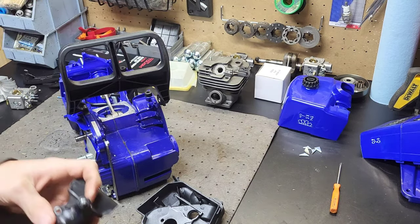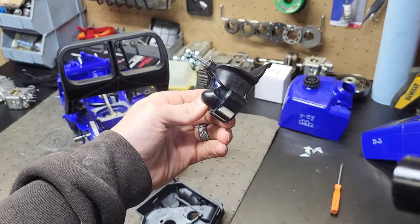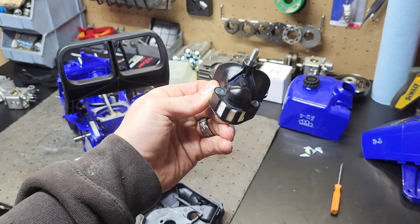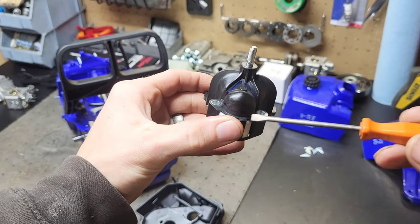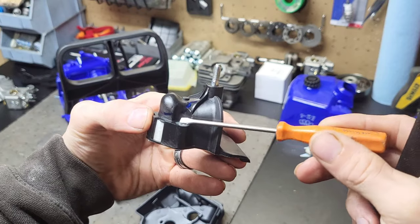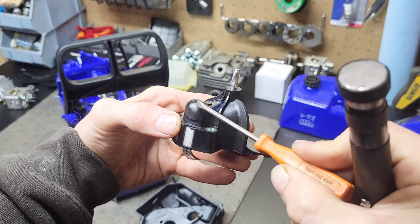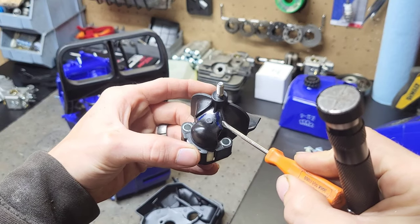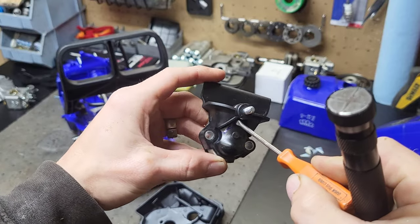All right, so now what we're gonna do — pretty much everything marked out right there with that paint pen is gonna get cut off. My plan is to get a hacksaw, set it here, cut back as far as we can till we hit here, then cut down, take this bottom section out, and then take our Dremel and get up in here and open this V up so the whole back section is wide open.